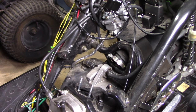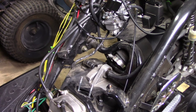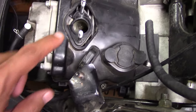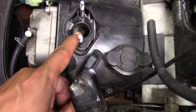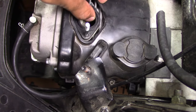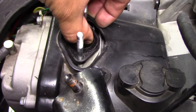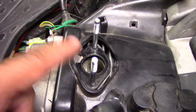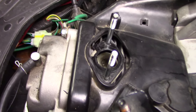There we go — now I can get down to the actual intake and see exactly what's going on with it. Now that the carburetor is off, you can see exactly what the problem is and I found it instantly after removing it. Right here there's a plastic little spacer that goes between the engine and the carburetor. I'm pulling up on it — that's what's letting the air in, leaning up my mixture by allowing more air into the system, and that's what's causing my problems.